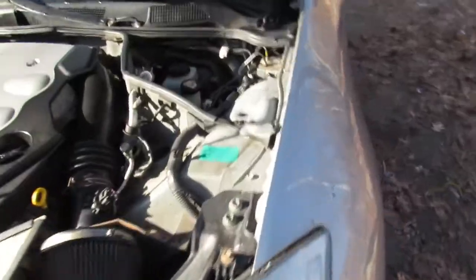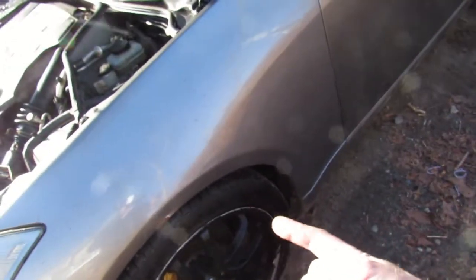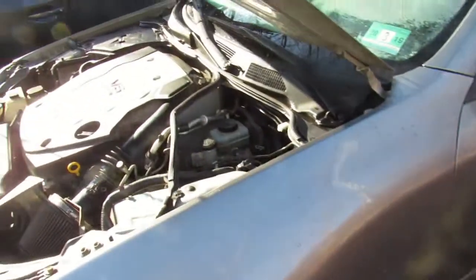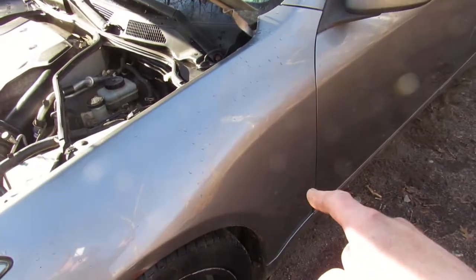But today, slave cylinder, I'm going to show you exactly where it is. It's quite simple. The hardest part is bleeding it, and it's actually on the driver's side. If you jack this side up, it's right underneath. It's quite easy to see. So that's what we're going to do. We're going to get the car jacked up, and we're going to get under there.